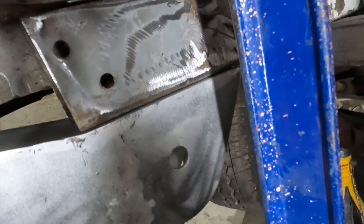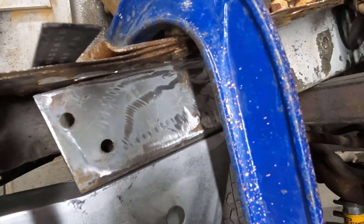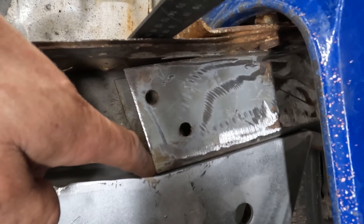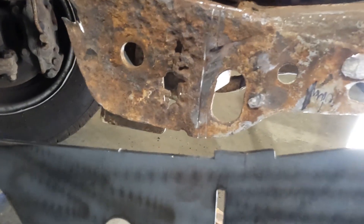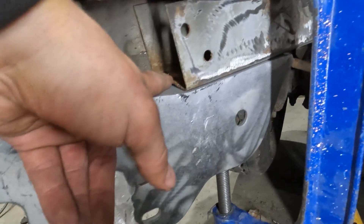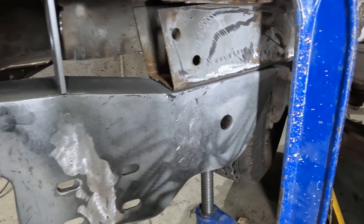It's difficult to find a reference — I did have a line scratched in the top, but with cutting metal away from the cross member, it's hard to tell. The end of this rail is going to be a datum point; it hasn't been cut, it's not rusted, and where that join is, it's perfectly lined up with the end of the next plate. Over on this side, we've still got the hole in place for the suspension. I've put a scratch just there to mark where the end of that plate will be, and lining that up lets us verify the hole is in the correct spot. We can then pull it into position with the clamp, put a straight edge flat on there, and that's how we'll line it up on the other side as well.